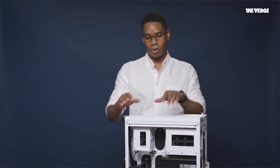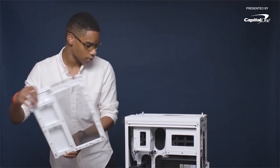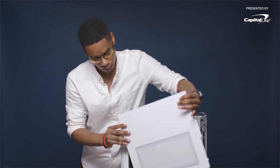Now that our internals are done, we're going to put all the panels back on — the top glass, side glass, front glass, and the back panel. Quick notes: the processor should be one of the first things you install. Try to build as much of your system outside of the case so you can verify everything works — you don't want to have everything installed in the case and a part not work. Check your motherboard manual to make sure everything is installed correctly. Don't rush anything, take your time. There are lots of tech tubers with review, installation, and how-to videos out there if you get stuck.